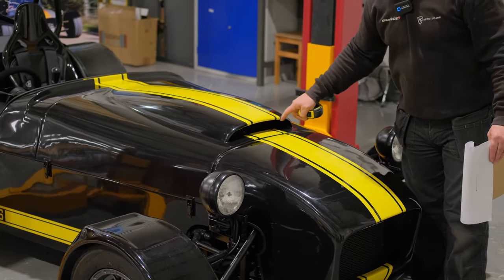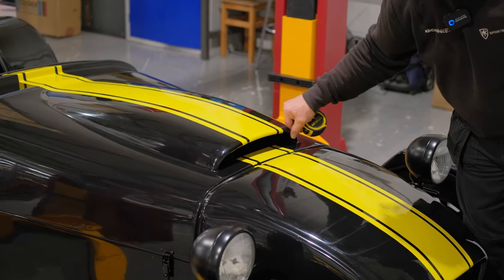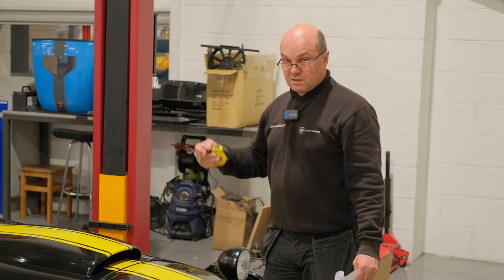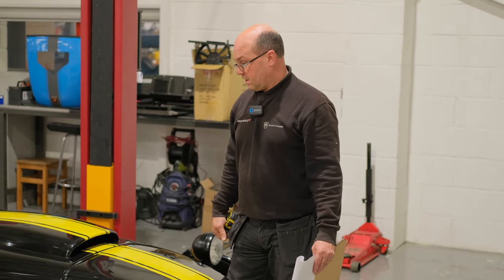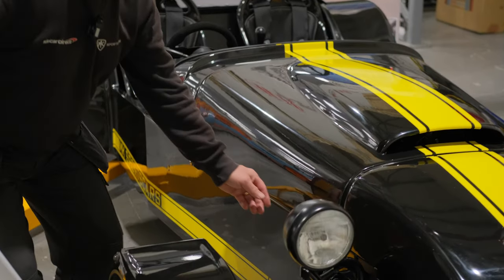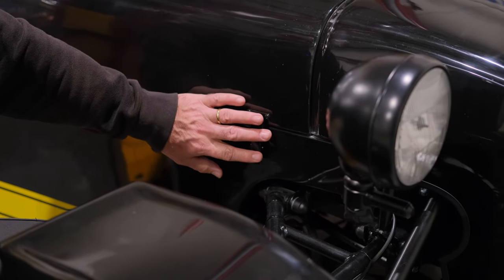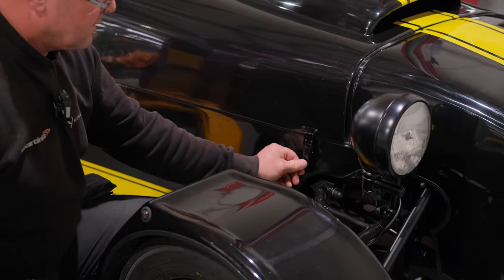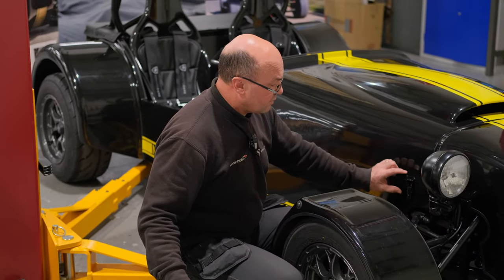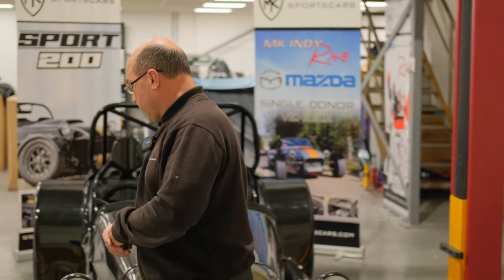That's why we put them in the front wing — it complies with the regulation in the M1 manual. For the bonnet scoop: this one is sunk back so it doesn't need trimming because you can't get your fist in there. But the front edge of any bonnet scoop must have a 2.5mm radius. Even things like Caterhams with metal louvres would need rubber trim, as those are classed as sharp edges. Your bonnet latches are also checked.